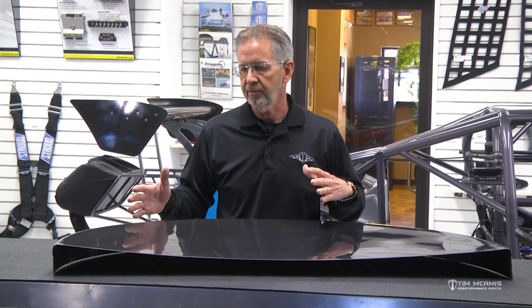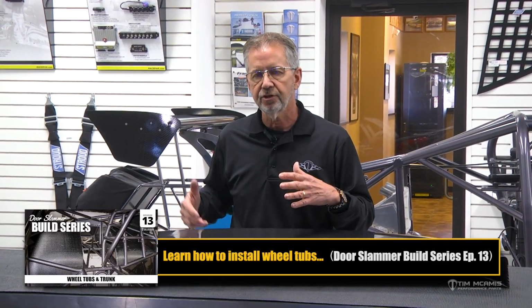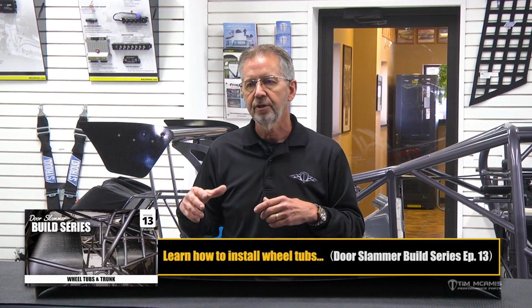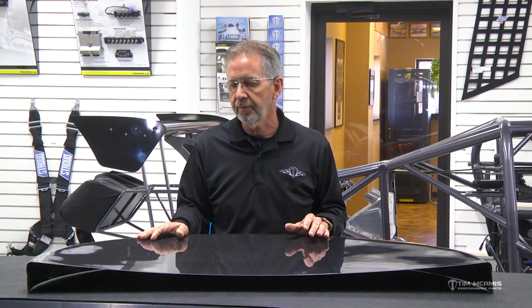So obviously when you put the full-size wheel tubs in, you've got the inner and the shell all in one piece. So you have to basically build that out of cardboard, so you have a template, and then you have to trim fit that edge, and then you have to fit it in the car, take it out, trim it, you've got to tape it, you got to protect the edge. There's a lot to it, and they're tough to get in there. You got to kind of squeeze them together and pop them up in the wheel opening.